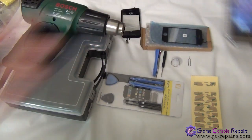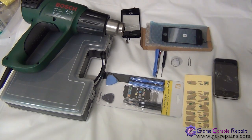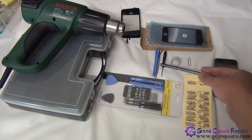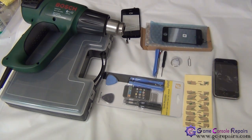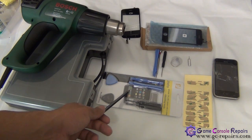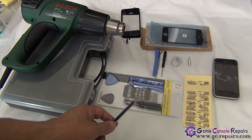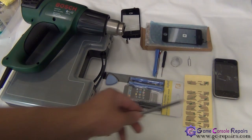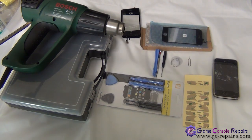These are the tools required to carry out the whole operation. You'll need a brand new touch panel, SIM tray opening tool, suction cup, Phillips double zero screwdriver, and a small micro precision screwdriver or pry tool. The best option is to purchase one of these iPhone iPod opening toolkits, which have pretty much everything included. You'll also be needing adhesive and a heat gun.